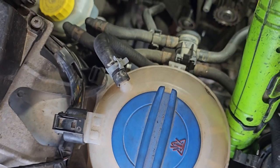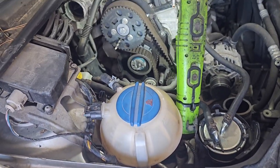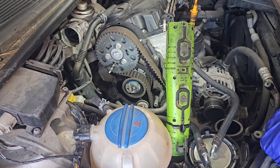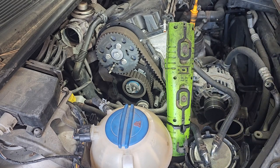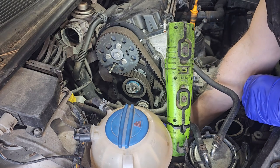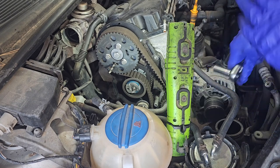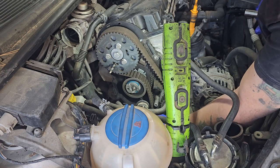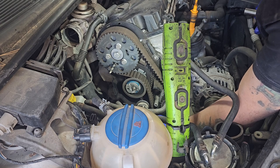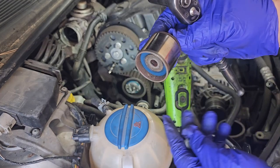Okay. The idler down here, there. I'm going to take that out and then we'll just be able to pull the belt off. So it's not my ideal way of doing them. Sometimes needs must. This has got a test in the morning. So just take off that little glide pulley. And that'll make the belt loose enough to pull off without disturbing anything. I mean, we're locked there, we're marked on the crank, but no point in taking unnecessary risks. So that's that one out, and the 13mm nut.